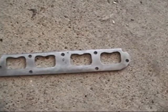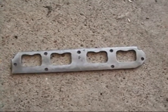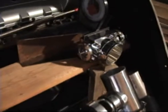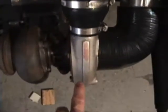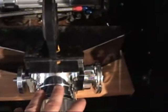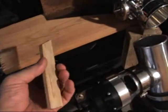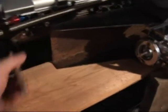I'm getting ready to try to build the runners that go from this to the intake plenum. My intake plenum here — you can see I've got my little steel box with the throttle body mounted to it. It's going to line up with this coming straight out of the turbo. I pushed it off to the side a little bit and got it where I wanted it, and I've got it level here. I built this little wooden stick that gives me an idea of how this is going to fit.